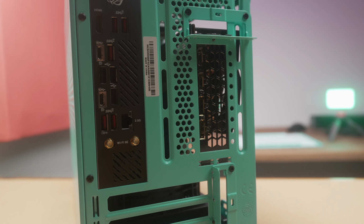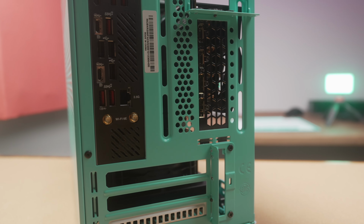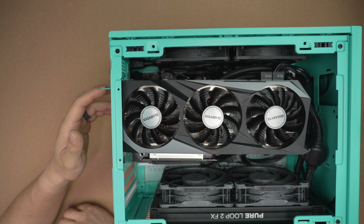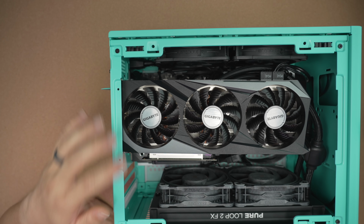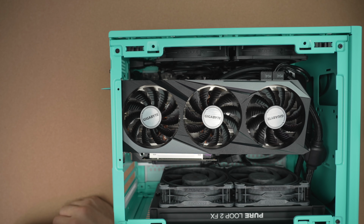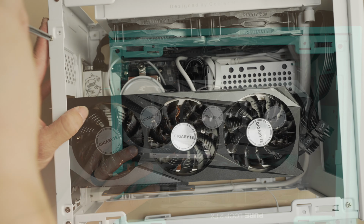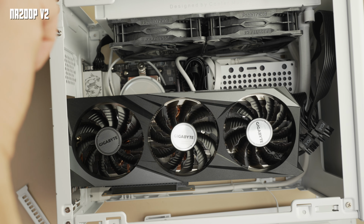The OG actually has better CPU temps for this setup, and I think part of this is due to the fact that in this OG setup, the more attractive exit path for the GPU's exhaust is the top fans, plus they're closer to the top fans, as opposed to the radiator here. It's farther away and there's less airflow here. So you have less GPU exhaust heating up the coolant. In the V2, the rad being at the top is going to pass more GPU exhaust through. So that would be my theory on why there's a delta here for the CPU temps in the gaming scenario.